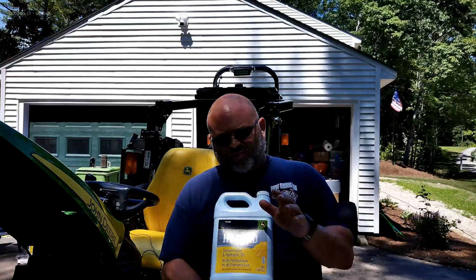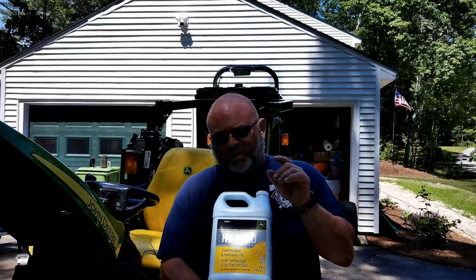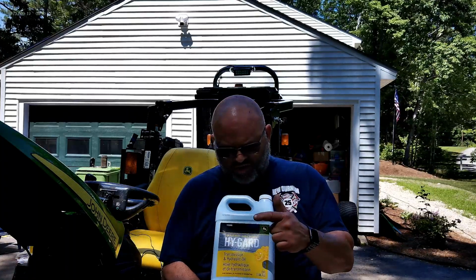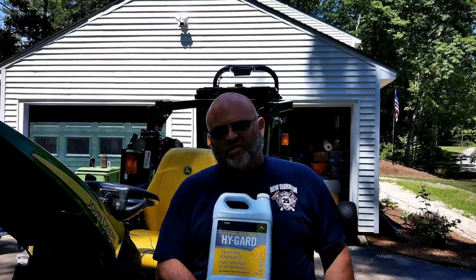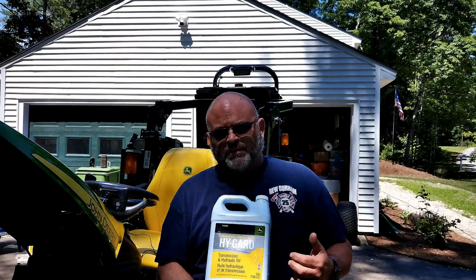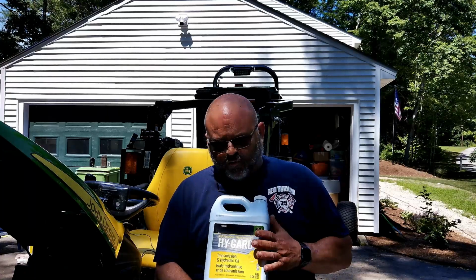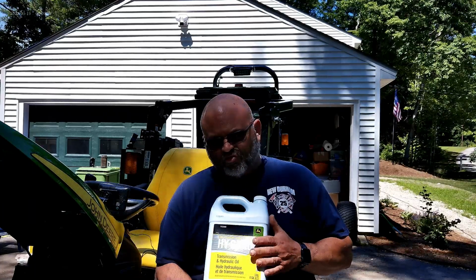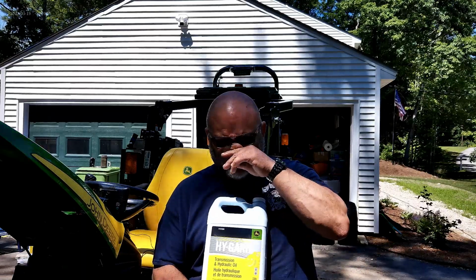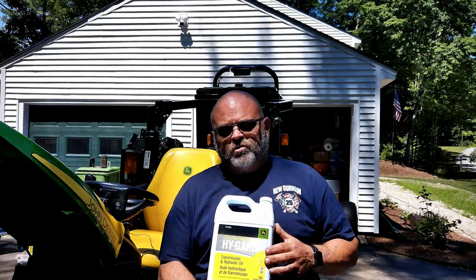I'm sure the 3 series are probably the same, but I know on the 2 series and on the 1 series, you want to use low viscosity HyGard. The stuff that I got in the wrong kit that I ordered was not low viscosity. It even says it right on the dipstick to tell you. So I had to go buy this at the dealer. So make sure you have the right fluid. I don't know what the differences are, but it does specify it very much so.